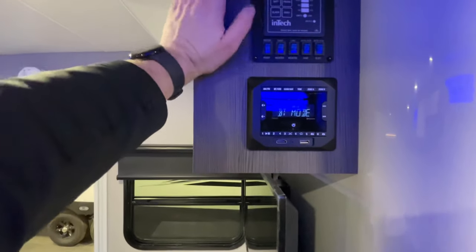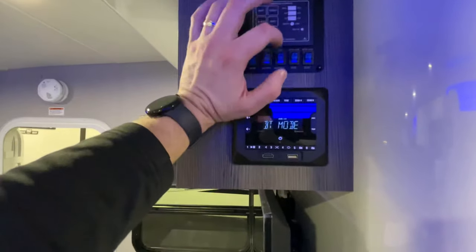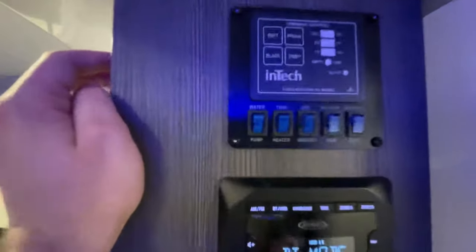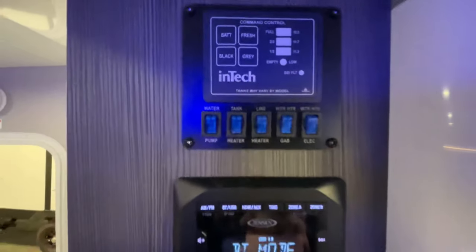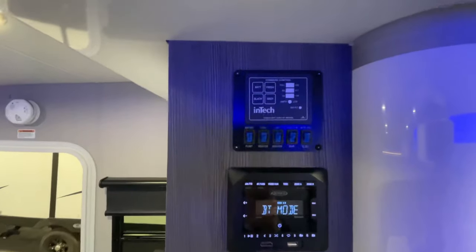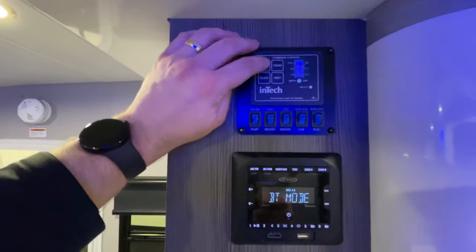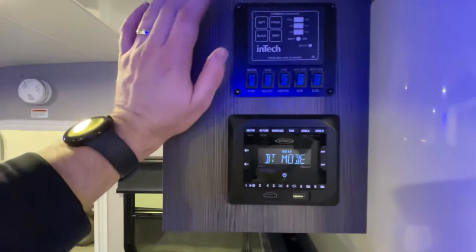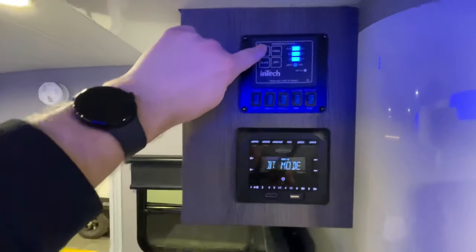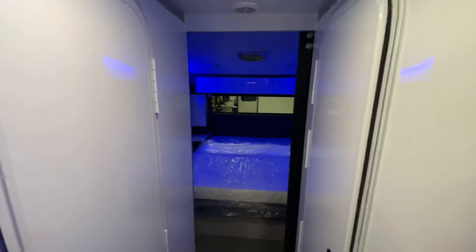Radio with Bluetooth. You've also got all your sensors — water pump, tank heater, line heater. You do have 12-volt line heaters as well as 12-volt tank heaters. That is an awesome feature — there's not many that are going to be giving you tank heaters, let alone 12-volt line heaters. Up here is going to be how you read your battery, all your tanks — fresh water, black, gray, the whole nine yards. Battery is going to read full right now; I've got this plugged into shore power.